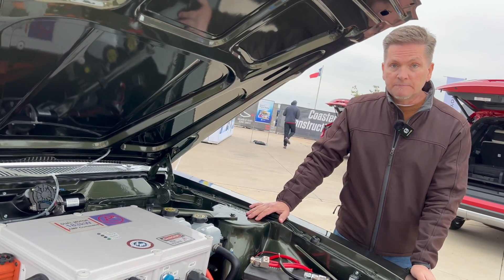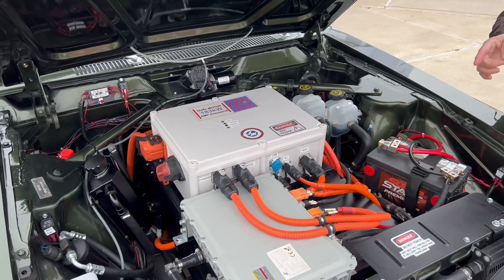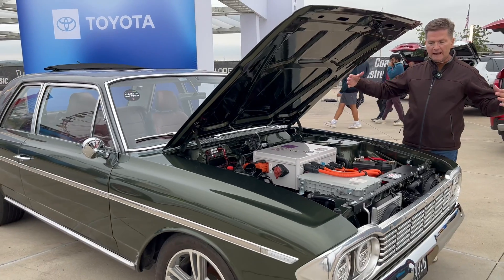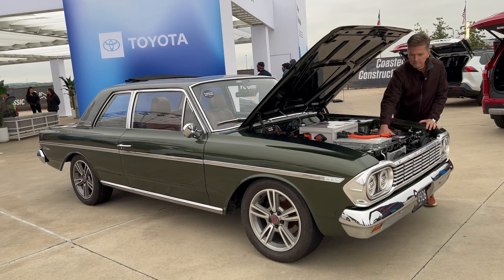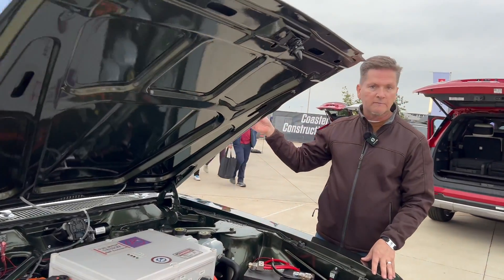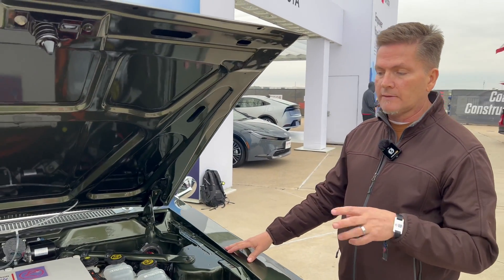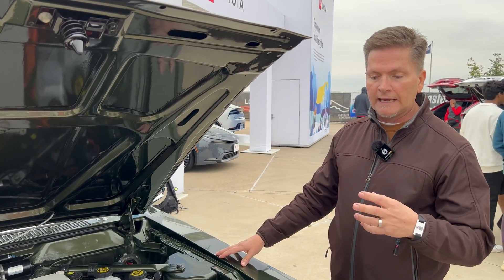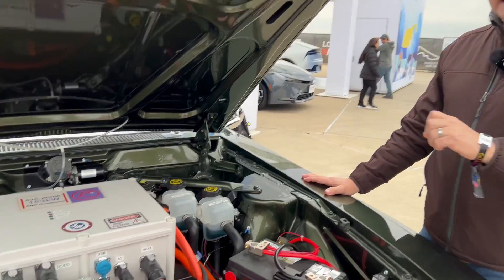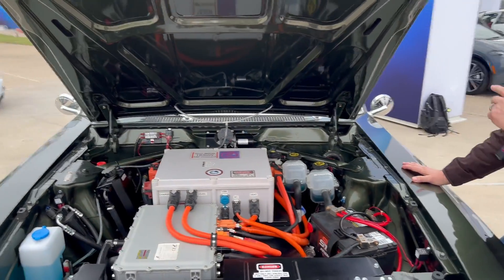What I was driving at the time was a Mercedes B 250e, and that is a small compact that Tesla actually provided the motor and the batteries for. So these are Tesla batteries out of a Mercedes B-Class. It's 36 kilowatt hours and they're very long skinny batteries — 12 battery modules, with six here in this box in front and then an identical box with another six batteries that fit between the frame rails in the back where the gas tank used to hang. I bought it already assembled as modules, separated it, and put it together, but I did build the boxes. They are liquid cooled like most Tesla batteries, so I did the liquid cooling loop and the BMS wiring.